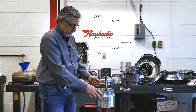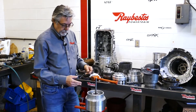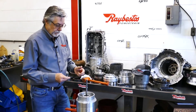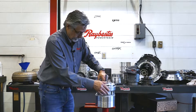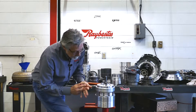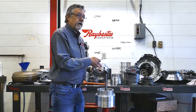Then you can go ahead and get this piston out the rest of the way. If you want to use air to get it out, you can use the output shaft and the ring gear — set that in there and you can air pressure it out. Or you can just turn it upside down on something soft, not a cement floor, but maybe a mat, and gently tap it — it will come right out. Putting it back in is just as easy. Put it back in there, try to center it on the piston, and then walk the snap ring back into its groove. There we go — there's the F-clutch for the 10R80.